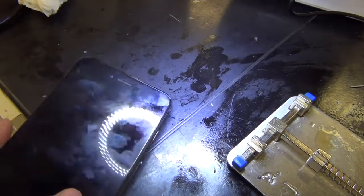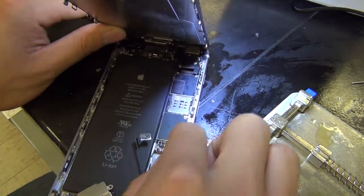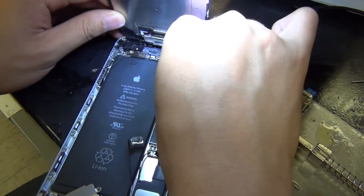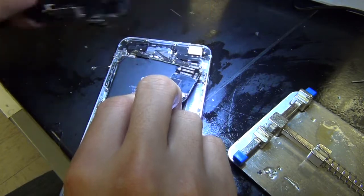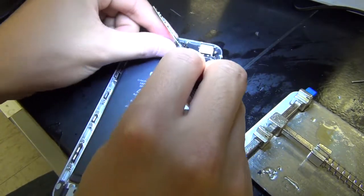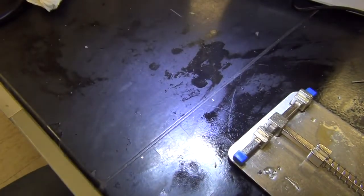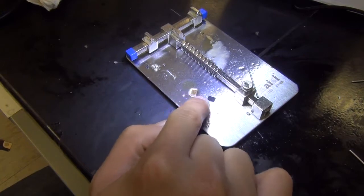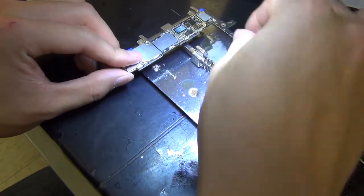To fix this issue I'm going to take the logic board out. I already pretty much disassembled this iPhone, but because there's no touch, the only way to turn off the phone is to unplug the battery — like so. I also troubleshot this board with another screen just in case the problem was in the LCD, but in this case it wasn't. The touch function doesn't work on either screen. So I'm going to put this away for now. You can see these are the ICs you want to get rid of and replace. This is the touch IC, and it's the same one used in iPhone 6 and 6 Plus.